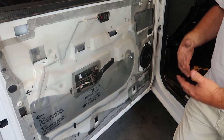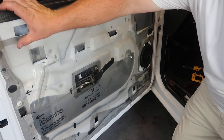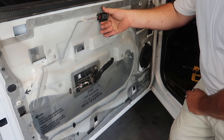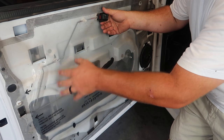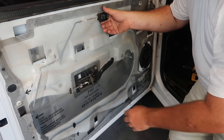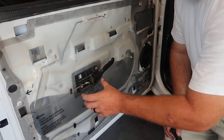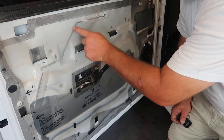Before you take your door panel off, find your lock switch or lock lever — usually that's going to be over here in the corner by the edge of the door, going up and down. On this truck mine is actually at the top in the middle. When it's in the door panel you push it one way and it locks, the other way and it unlocks. This right here is the rod you want to connect to — this is the rod that goes to your lock mechanism from your lock lever. That's what your actuator is going to control, not the door handle rod. You don't want to connect it to the door handle.